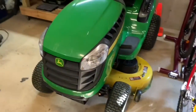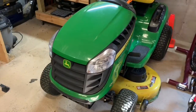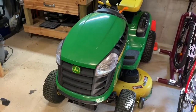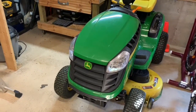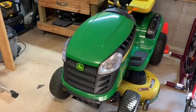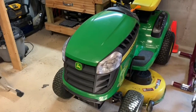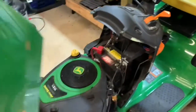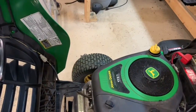Why do I think that? It just started last week, unfortunately when my 12-year-old son was cutting the grass. All of a sudden it started spewing out white smoke - definitely burning oil. Let it cool down, pulled the plug, and sure enough the plug was fouled with burnt oil. These Briggs and Stratton engines - this one's the 17.5 horsepower, then you have the 19 and 21 horsepower.